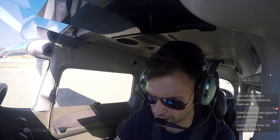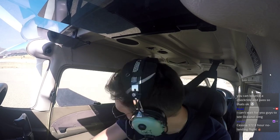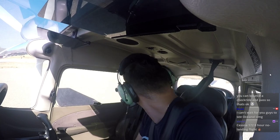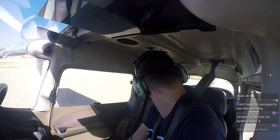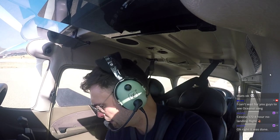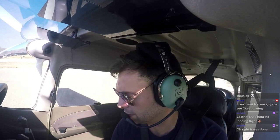experience. So let's get our pre-takeoff checklist going. So we've got flight controls are free and correct. No one flipped the cables while we were having lunch. That looks good. Check the trim. So we got fuel on, both mixture cutoff, throttle, flaps are up. We've got our appropriate lights are on, master's, mags.